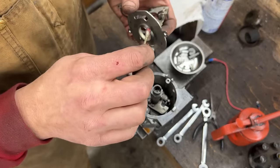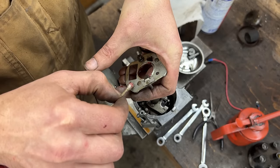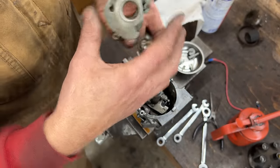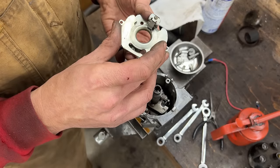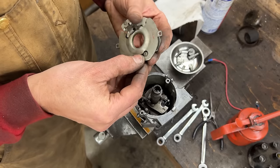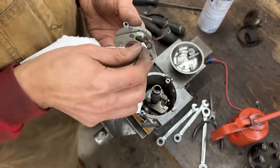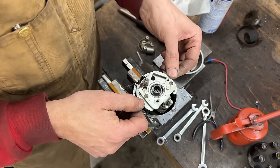We're going to lubricate a little bit here, because this is the actual bearing. Actually, these here are just like thrust washers, I guess. So very little. Now to assemble it, we have to put this under the spring first and then click it here. And there you go. That's it. Clean this excess here. Now that's how it goes, with this pin towards the vacuum advance unit.